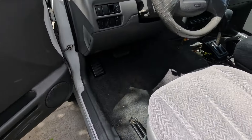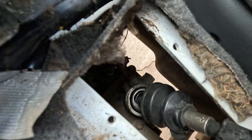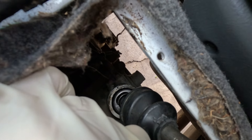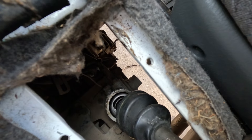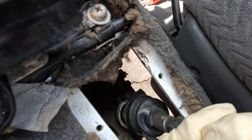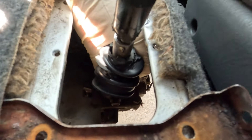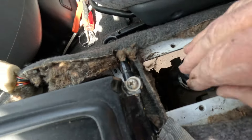One of the first things is to take the four-wheel drive shifter out. I've already removed the boot — that's pretty straightforward. There's a retaining ring that has to come out; you push it down and turn it about 20 degrees, and the whole thing pops out — it's spring-loaded. Best thing is just to use your fingers. I usually put it in the next range, which is four-high. Pushing it down and turning it — there it comes, it popped out.